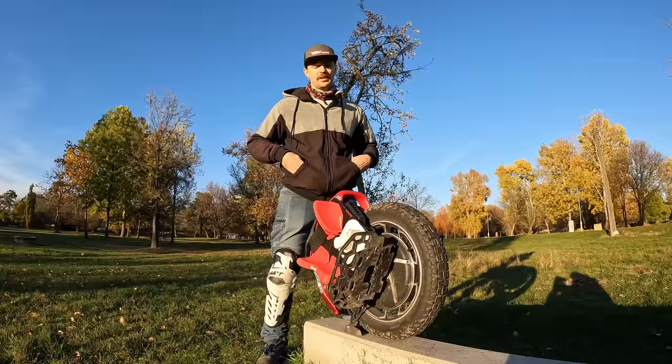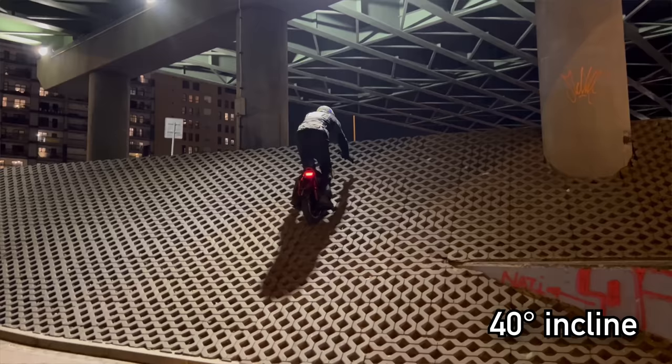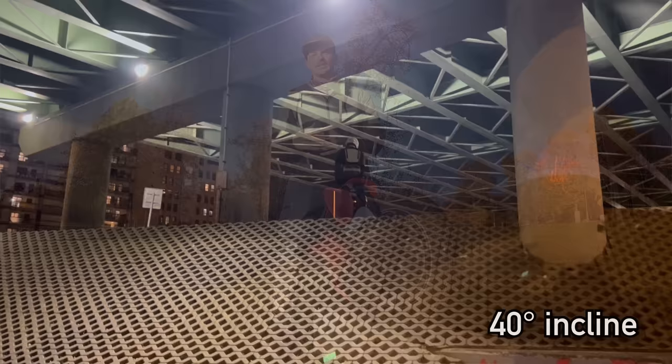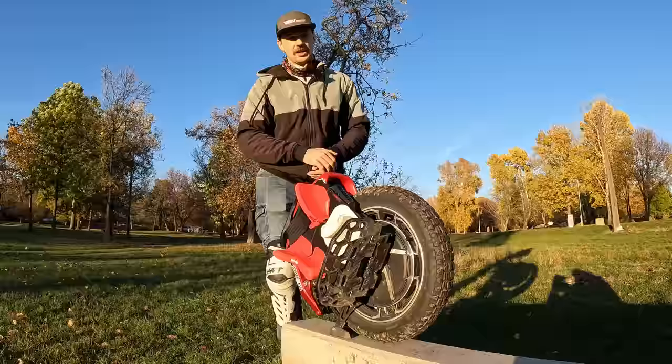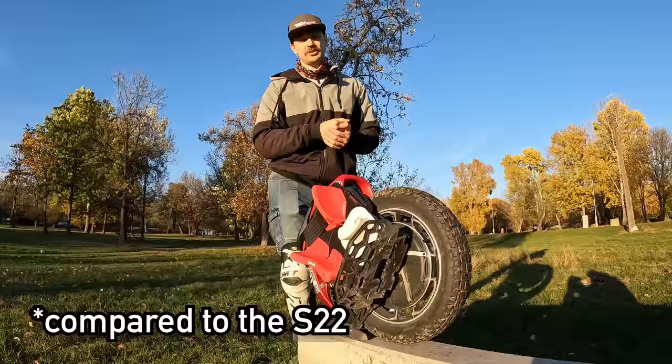Now, let's talk about performance. Well, really, really short part in the video. Performance will be a big difference from the S22 to the S22 Pro. We get a lot more torque with a higher torque motor and a different control board on this wheel. So if you want to convert an S22 to an S22 Pro, you would need to change both the motor and the control board. When it comes to the performance, it is a lot more fun to ride. It's more zippy, more reactive to your lean, but you have slightly less edge on the top speed end.